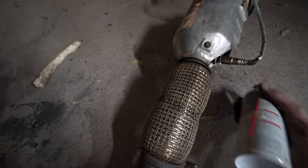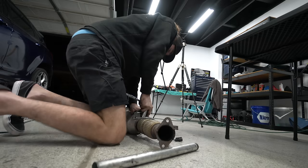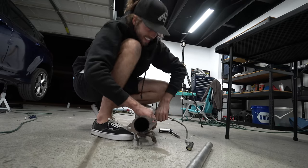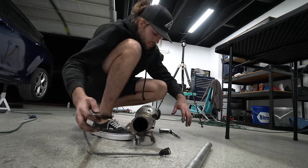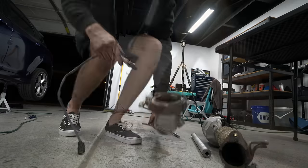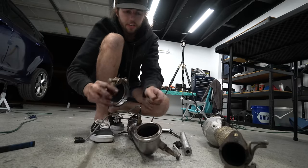Got one off, let's get this one on camera. I didn't expect to do this tonight and I don't have any anti-seize — if you plan on leaving the downpipe on for a long time, put anti-seize on these threads. Make sure you put the O2 sensor back on the correct ones — this one's lower. That sucker's tight. Make sure you put your ring on.